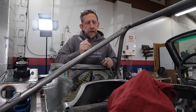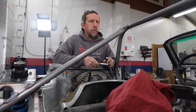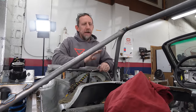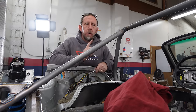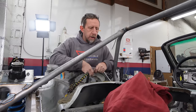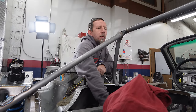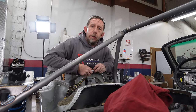We're going to put the distributor in. We need to know that the engine is at top dead center on cylinder one. We may have been a little antsy, and by we, I mean Ryan, when we were taking things apart. I'm sure the engine is not at that position now, so I'm going to pull a spark plug so I can confirm the position of our engine when we put the distributor in. I was thinking this is cylinder one because this is our spark plug that's broken, but we're going to have to pull two spark plugs. We'll pull this one and replace our broken one, and we'll pull that one and confirm that cylinder number one is at top dead center on the compression stroke.